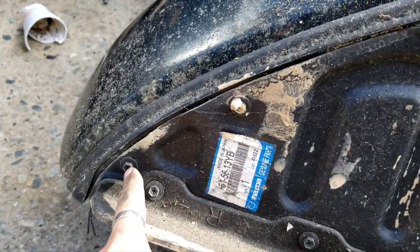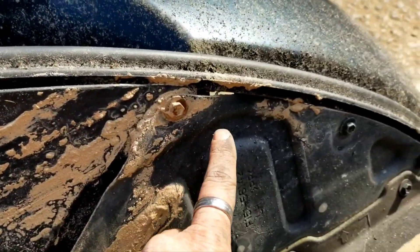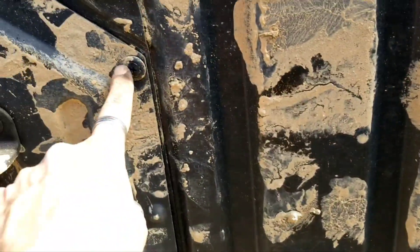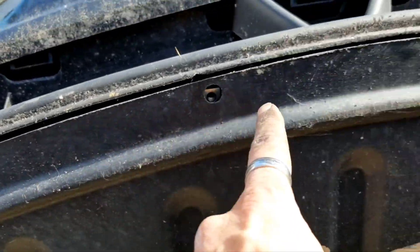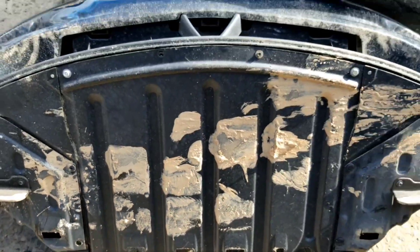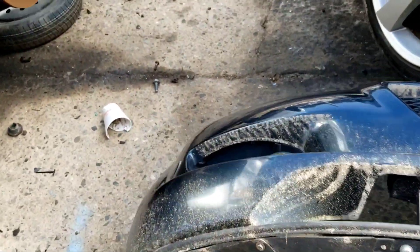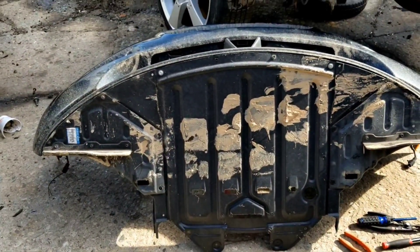Looking from the underside, you have all these pieces here, all these that disconnect. In your vehicles, if you're just removing simply the bumper cover and don't want all this extra splash shielding, I would remove these all along here and detach it that way. That way this whole piece should come separate. Worst case, you see where there are other fasteners that you may or may not have to detach to get it loose. But I want this whole assembly for mother, just in case she needs it. Better to be safe than sorry when cars get old. It's a 2004 RX-8 bumper cover removal.